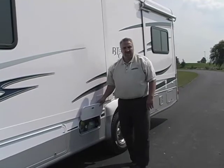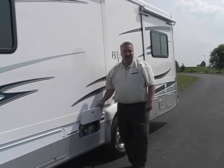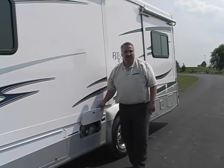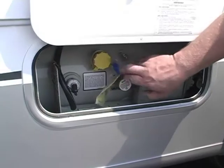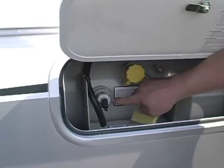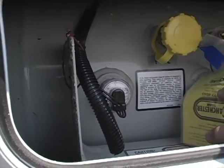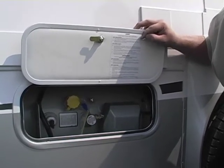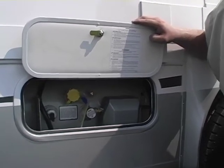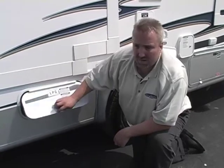This is something that needs to be serviced by trained professionals. LP is not only an extremely flammable gas, but also has the ability to frostbite very, very quickly — it's extremely cold. I want to give the caution that it be handled very carefully and that wherever you have your coach filled up, it be done by trained professionals. On this unit you have your standard on-off valve, your fill point, and bleed-off. Gulfstream has both an internal monitor panel with gauge as well as an external gauge showing full, half, quarter, and empty — so you have two ways of double-checking your system. I'd also like to highlight the warning label on this door: it's made for propane, not for natural gas, along with other warnings you'll want to be aware of.